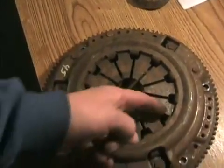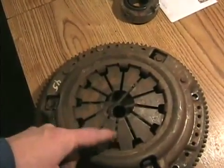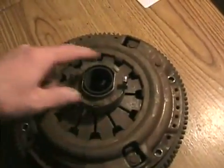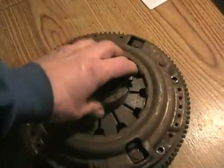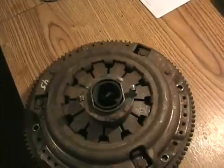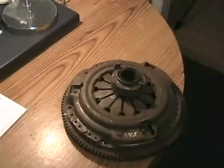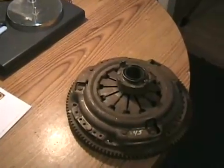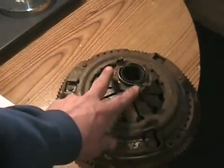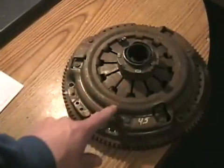That's why it won't go into first gear until the motor is not turning. Also, one or more fingers can break off, sometimes getting lodged in there and causing slight vibration because it makes the engine slightly off balance. When the release bearing pushes on it, it's not releasing the pressure disc all the way, so the clutch drags and it's hard to put in gear. Very common on cars with hydraulic clutch release: the master and slave system leaks, gets air in it, or is low on fluid, so when you depress the clutch the release bearing isn't pushing down far enough.